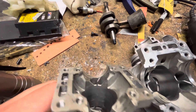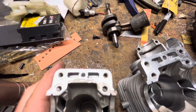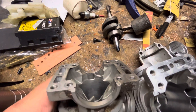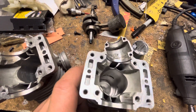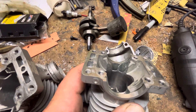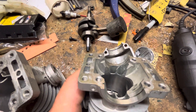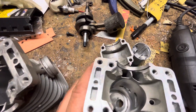You can see it's got peculiar transfers that don't match on each side. All I did was I tried to match it, but I missed on one side. I ended up just kind of scribing - I think it was 80 or 100 thousandths - just scribed a line around it and tried to keep within that.